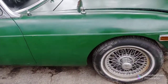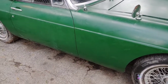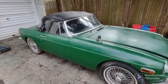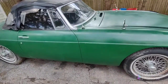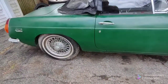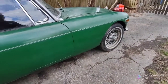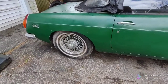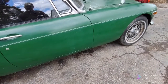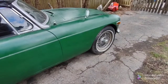So really quick — I added brake fluid, we kept pumping the pedal, it went down a little bit, then I added more, topped it off, and it didn't go down any more. The pedal is a hard pedal now, so I seem to have some brakes. I didn't go through these brakes yet, but I don't see any fluid under the car by any of the wheels. So maybe the calipers are good, and maybe the wheel cylinders are good. The master is questionable, and I didn't change the rubber hoses — those could be shot too. Just because you don't see anything leaking outside the car doesn't mean that your brake system is sound and won't let you down.